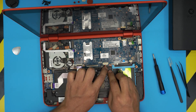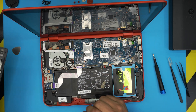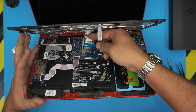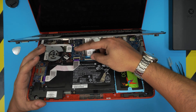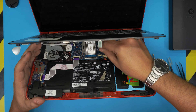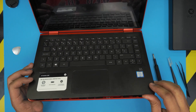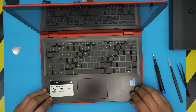The last step is to plug in the battery connector — push it straight inward — and accommodate the cables. Grab the palm rest and bring it over. Open the keyboard lock, slide the keyboard flex cable in from the back at a 45-degree angle all the way through, hold it, and close the lock. Open the trackpad lock, slide in the trackpad flex cable, and lock it. Then bring the bottom cover over and pinch the top and bottom together — you should hear a few clicks.